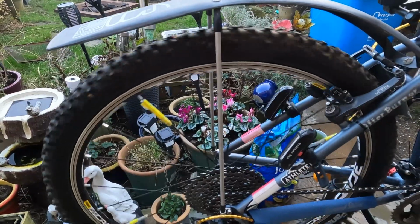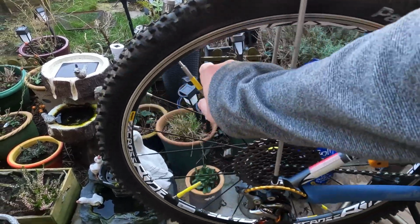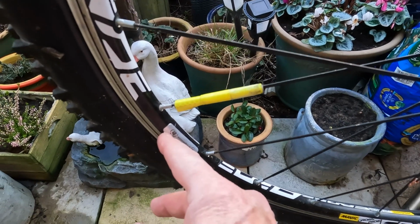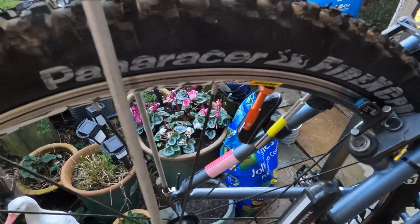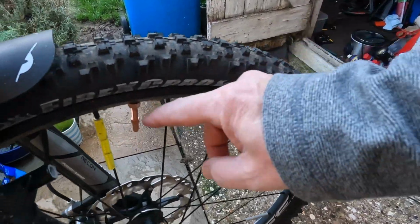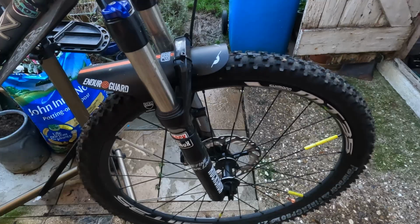The trouble with bike wheels is they become unbalanced. So that's why I put on a few of these reflective tapes here, and this here, if you can see, is a golf club weight, which helps to counteract the weight of the valve. Now I've done the same on the front wheel. You can see directly there, you go directly down, and there's some more golfing weights, 3 grams each. So that's 6 grams on that wheel. Yes, so that wheel's now perfectly balanced.